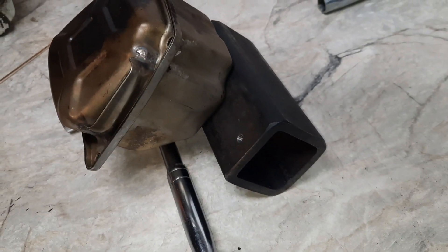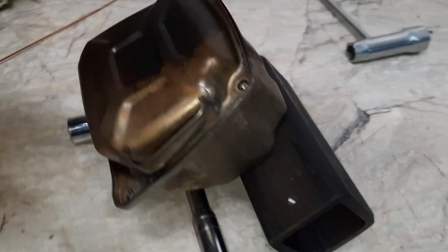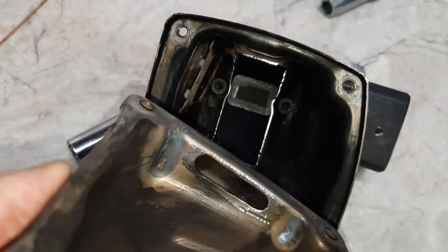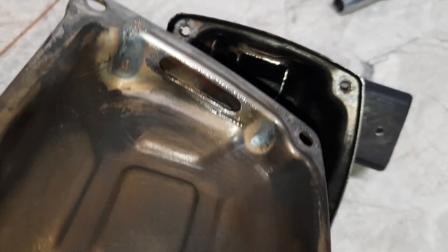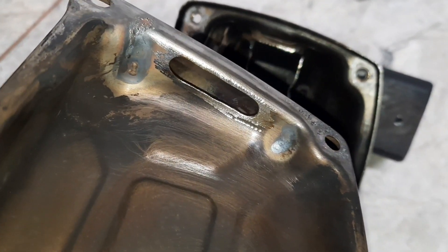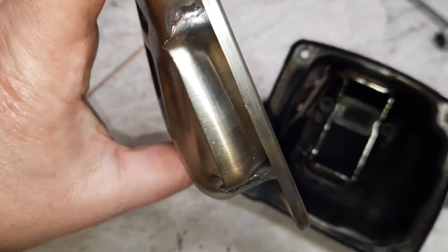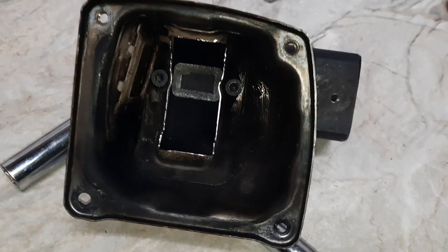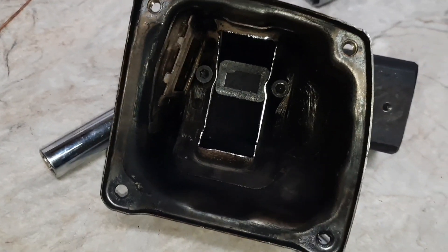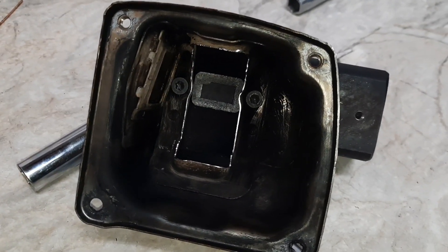Here's the finished muffler cover — it's one of my medium-wide deflectors, all trimmed up to fit. Nice hole opened up on the inside edge of the front cover there. Opened up the baffle, lightly scraped the carbon out with a wire brush, blew it out, hit it with some brake cleaner to make sure it's nice and clean. We'll get this mounted up and see what kind of power the ported cylinder makes.